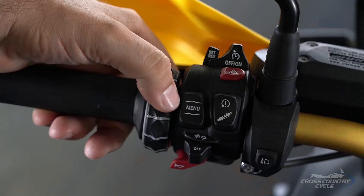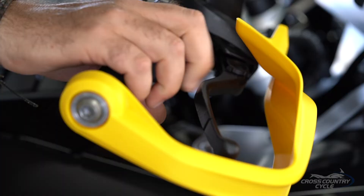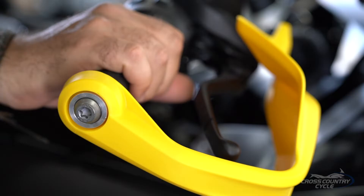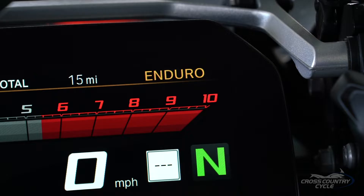When you get to your desired cruising speed, press the small lever forward and your cruise control speed will be set. If you want to accelerate, press the button forward; if you want to decrease your speed, pull the button back. To deactivate cruise control, activate one of the brakes or the clutch, or roll the throttle back. To turn cruise control off completely, slide the switch back to the left.